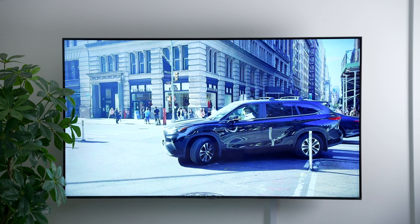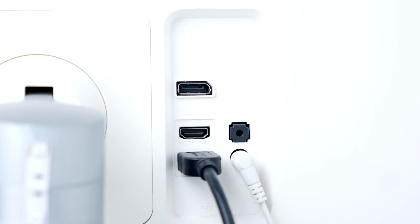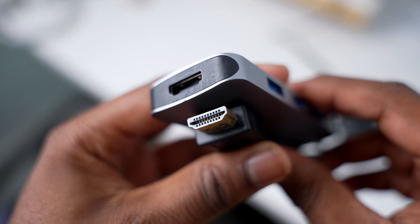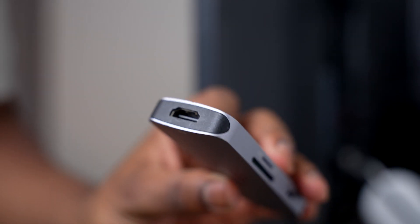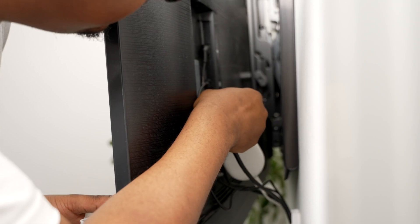The final method to connect iPhone to TV is using HDMI, an option that doesn't require Wi-Fi. It works with nearly any TV that has an HDMI port, making it perfect for bad Wi-Fi connections. The downside is that you need to keep your iPhone plugged in to the TV, so it's not wireless at all. You need some kind of adapter. If you have an iPhone 15 or newer, use a USB-C to HDMI adapter and an HDMI cable. For older iPhones, you need to use a Lightning to HDMI adapter. To set up, plug one end of the HDMI cable into your TV's HDMI port.